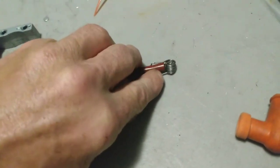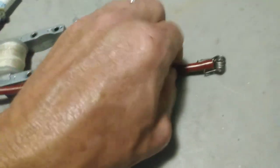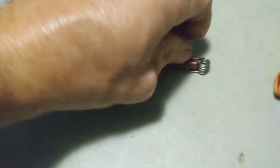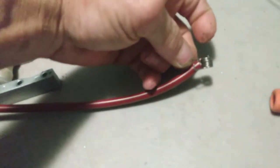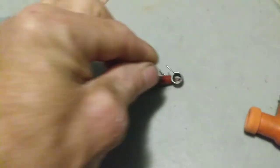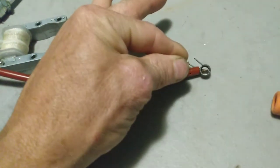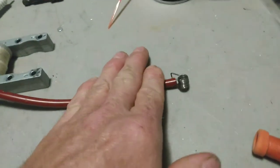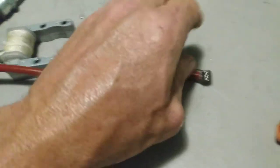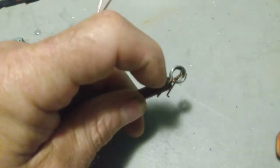So what you need to do is take this and cut it right here, back past the holes. All that happens is these little pieces here are crimped into the holes. All they are is just crimped into the holes. You want to cut past this with a razor blade — just take a razor blade and kind of slice it. Make sure you use a new sharp one. You'll go down and feel the wire, then roll this with the razor blade on it, and slide that portion off. That will leave the wire exposed.